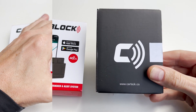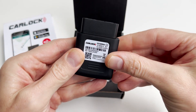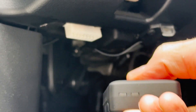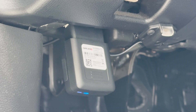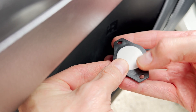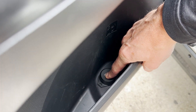Shake the sensor every few seconds until you successfully trigger the alarm. The sensor works in conjunction with the Carlock OBD device. Insert the device into the OBD port on your vehicle. Once inserted, the lights should flash blue. Use the provided adhesive to affix the Bluetooth vibration sensor into your car door pocket.